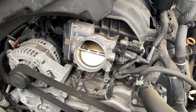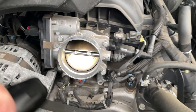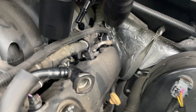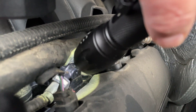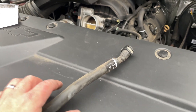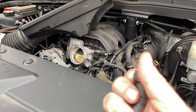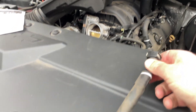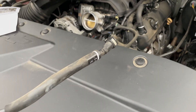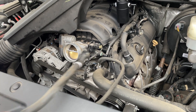We got the air box off the throttle body and set it to the side, still connected to the filter. We're going to disconnect the hose right below — use that gray tab — and then disconnect the other end to get it off. The trick is it's very difficult to get your right hand under there. You have to press from the underside so it loosens up. If you work with both hands, use your left hand to twist it and your thumb to squeeze. Pull from the front end first to disconnect, then pull the back side straight out.